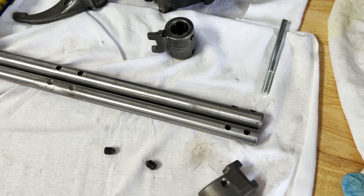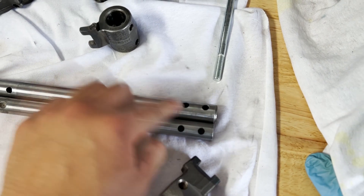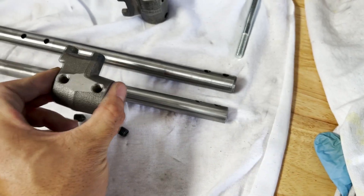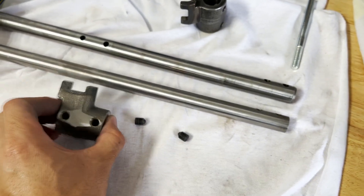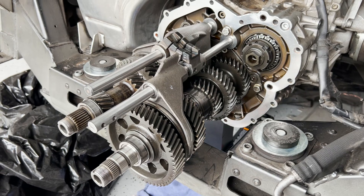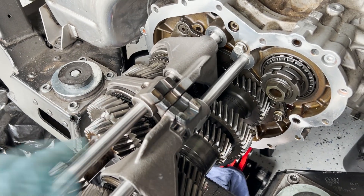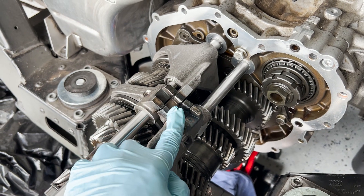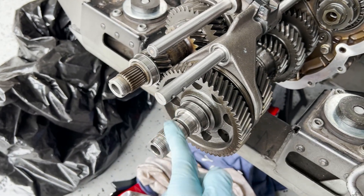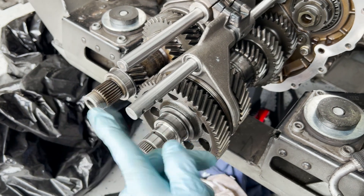After hitting the manual shift fork with an angle grinder, I managed to cut it pretty close to the length of the Artronic shift rod. The next step is to install the shift rod along with the reverse engagement collar, then lock it down with threadlocker. The shift forks and rods have been installed in the transmission. The engagement collars are definitely way thicker than the Artronic ones. I cut off around 8mm to make this shift rod compatible with the Artronic bump stop.